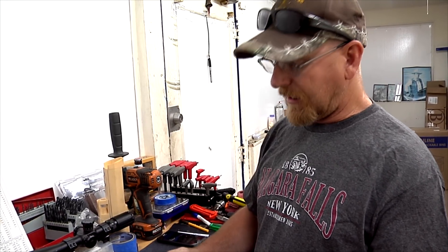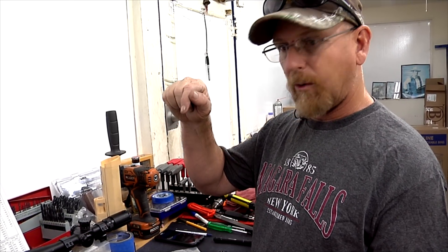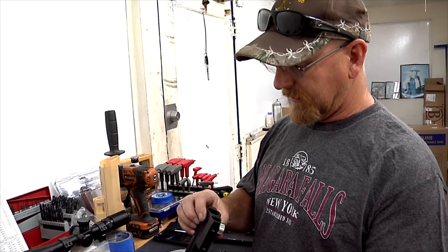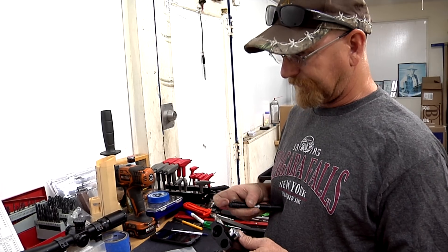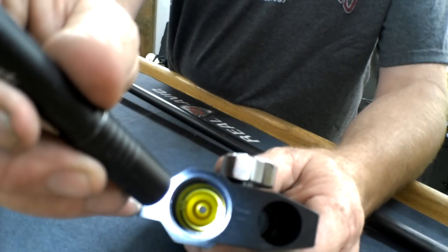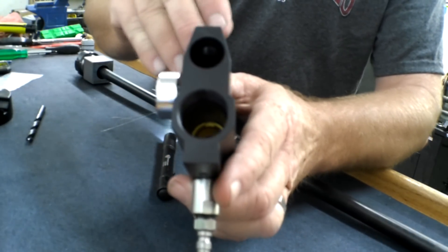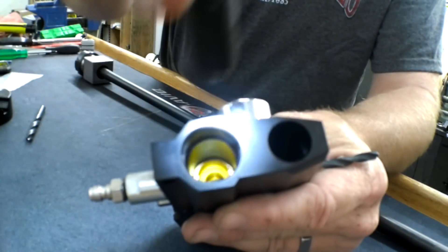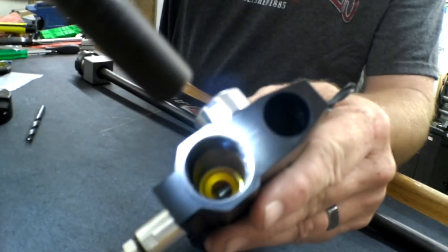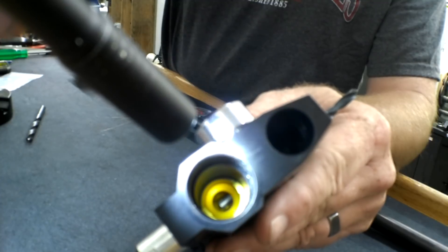The N size letter at 0.301 is still a good size. It fits right in the transfer port hole, and the only thing you're drilling out is the actual aluminum valve. You can see the valve in there — this is the drill bit that fits the hole in the valve. You can see it down in there; that's the only piece we're actually drilling out.